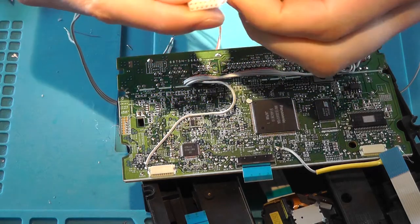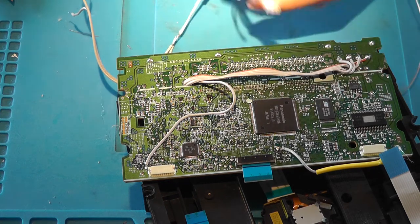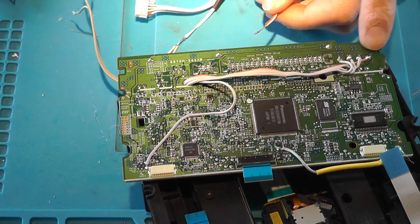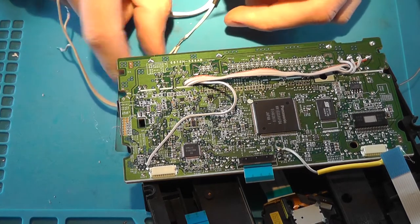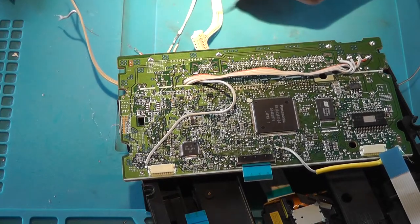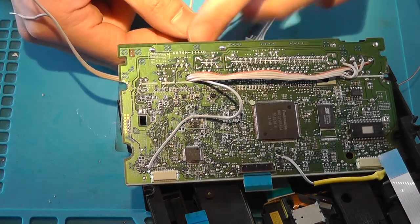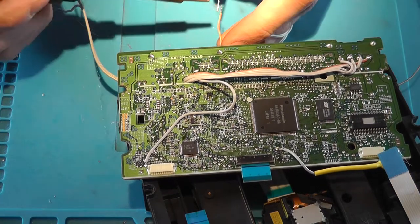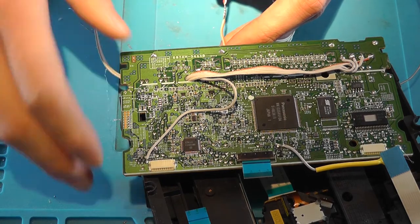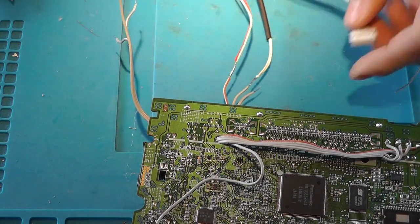So again, connector. Connection 6 and connection 2 form the 12 volt pair. And the 12 volts located at the outside of the PCB. So that's the red coated wire. So we need to solder those two together, right outside of your view. Like that. Again, don't put the heat shrink over it.